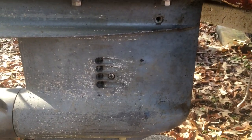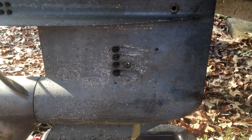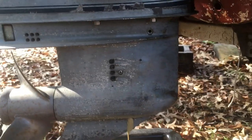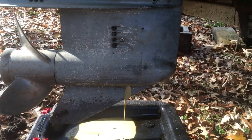We definitely have water getting into our lower unit, so we'll continue to let it drain. One thing I heard is that you're supposed to let this drain for an hour before you fill it back up again. You want to make sure the motor is sitting very vertical to allow that to happen properly, so we're just going to let this drain for a while.